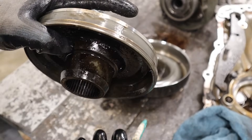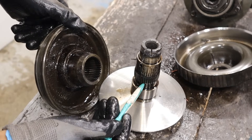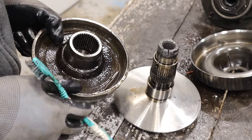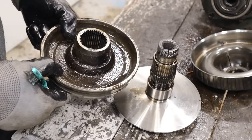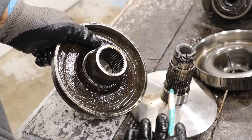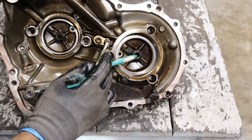On Nissan vehicles, they actually use rubber, and those rubbers fail and then you can no longer hold pressure in the variator. So it's good that Toyota was able to come up with a sealing system that doesn't have that failure point. The other huge difference on the Jatco's versus this one is that you've got full gear teeth over here and the inside is splined. So this moves up and down easily, but it's also got enough teeth so that it can transfer torque and not wear. Surprisingly, on the Jatco transmissions, they don't have any splines — instead, they just have three grooves with steel ball bearings. After a while, with the back and forth movement and vibration, the races and the balls themselves start to wear out, and you get a shuddering sensation. Eventually the balls drop out and it can no longer hold any torque. I'm very glad that Toyota didn't go in that direction with these variators because those were really obvious failure points.